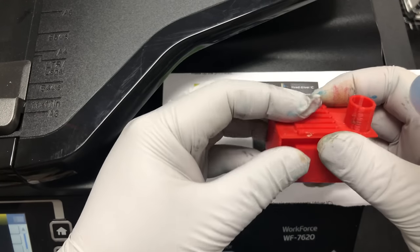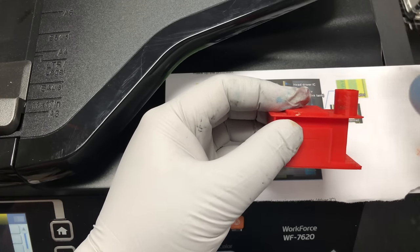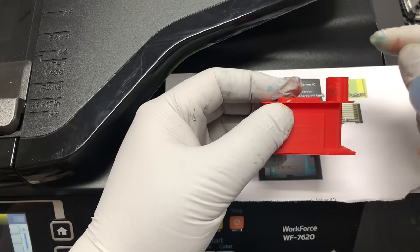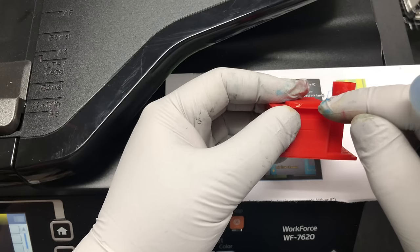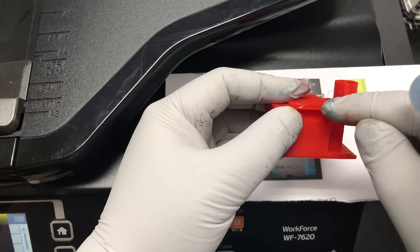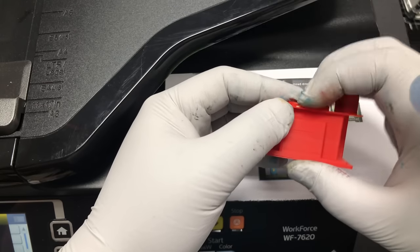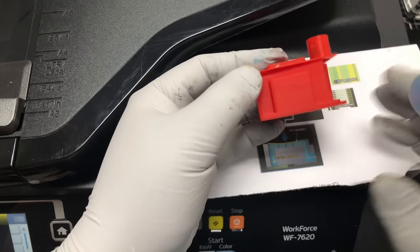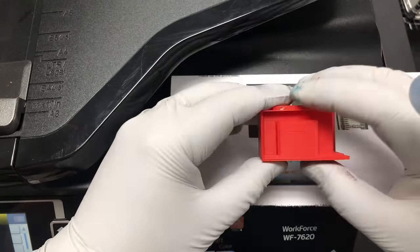So you have three things again. IC, the chipboard, which cannot get wet, and you get TFP, thin film piezo, okay, which is this, just think of it as a piano key. And then you have a little tiny hole, which is the nozzle. That's all it is for the printhead.